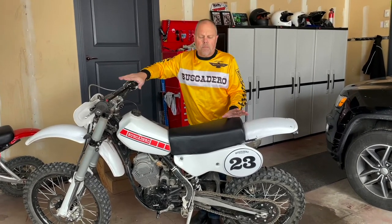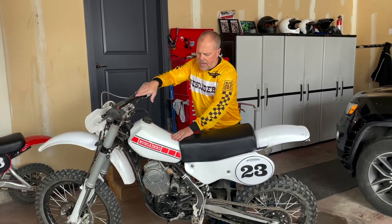I feel like this bike fits that XR200, XR250 slot that I miss so much. The exception is that this bike has never been carbureted well — it's always had carburetion problems. I think the root of the problem is a bad float valve, so it's constantly flooding itself. Sometimes when I park this bike, the overflow just spills out onto the ground with gas. Other times, after landing from jumps, it'll burble and gurgle and sometimes stop completely. If you're just riding on the street or smoother trails, not a problem. So what I wanted to do was take a bike I'm really thrilled with and sort out the last little problem.